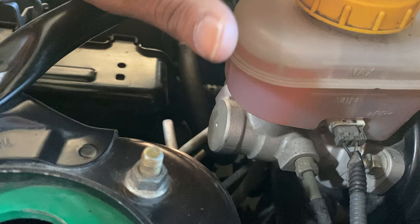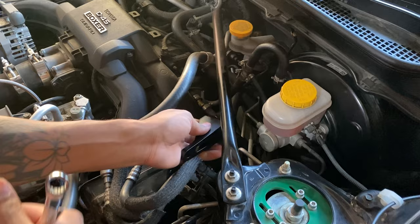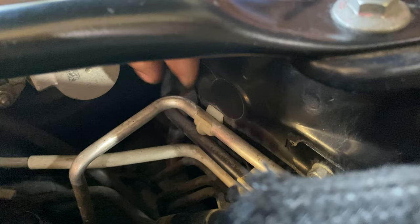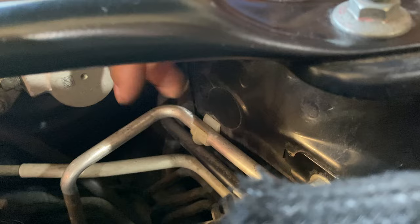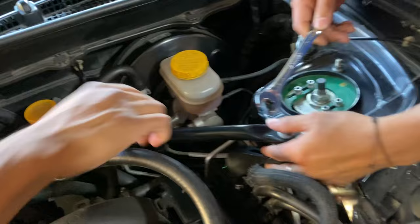Do you know what this does? No, I do not — let me show you. So this right here moves ever so slightly, and with this piece it's gonna sit just like that. It's gonna keep that from moving and give you a better pedal feeling on your brakes. This bow is gonna get removed — from factory they cover up these two holes, one's a square and one's a circle. You're gonna use the circle one, going through the circle just to keep the factory coverings. It sits like that, and then you'll take a 13 mil and adjust that green part as needed, then lock it down with the nut.